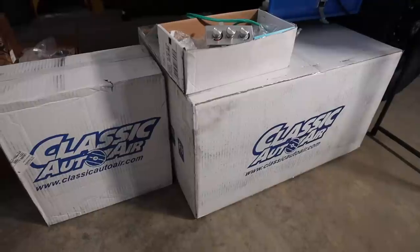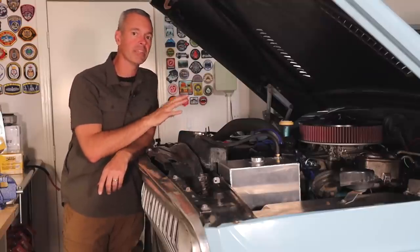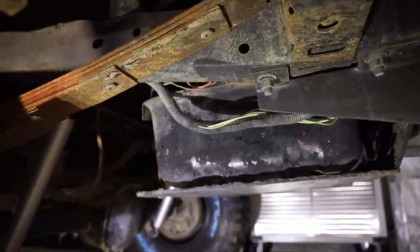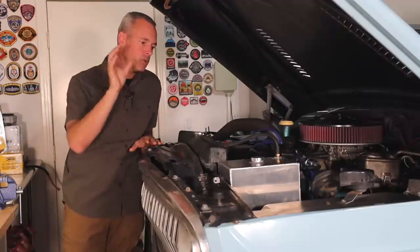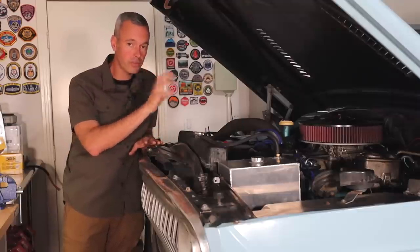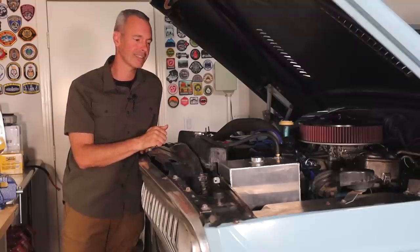I also have an aftermarket air conditioning and heating system going in — there's no AC currently and the heater doesn't flow great, so the whole system will come out and a new one will go in. That's a big job I need to set time aside for. There's also an auxiliary fuel tank — about 20 gallons — that sits in the back where the spare tire is, but it's not currently connected. The previous owner said at high altitude the fuel pump couldn't pull from it. I'm going to hook it up and possibly add an electric fuel pump. That would give me 41 gallons total, which would be great since current mileage is about nine miles per gallon.